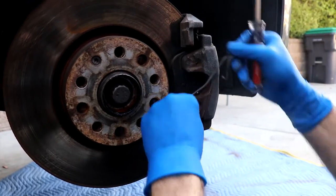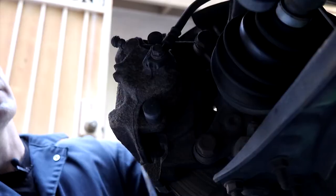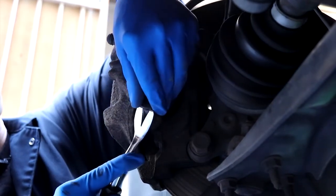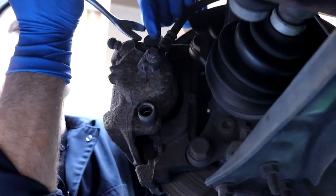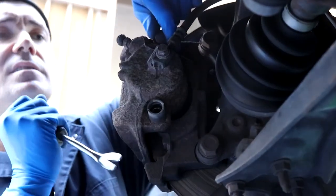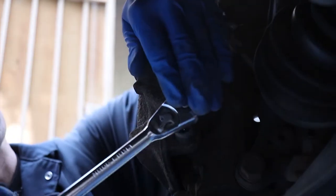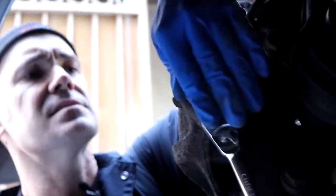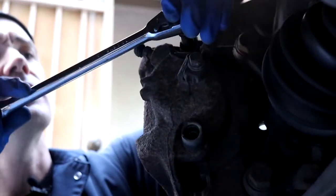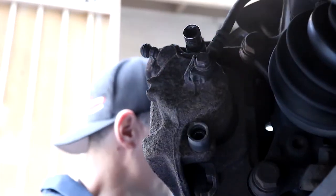This one has got a little corrosion. Next up are the little dust caps for the caliper bolts — I just have a little pry tool and they just pop right off. They're in a rubber boot so they come off easy. Then take your 7 millimeter Allen and I like to just break these loose by hand, then switch over to the Milwaukee.